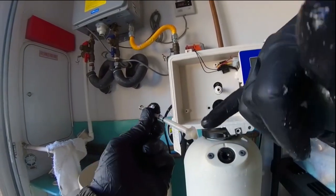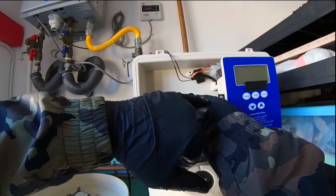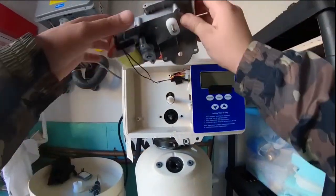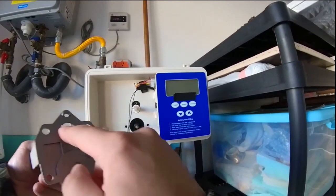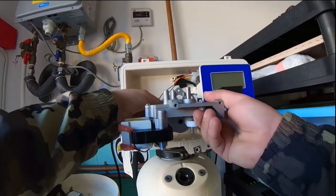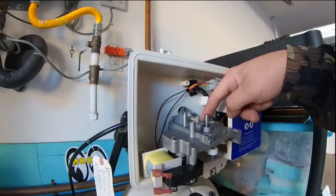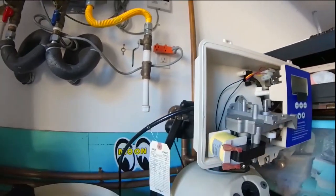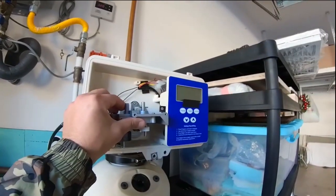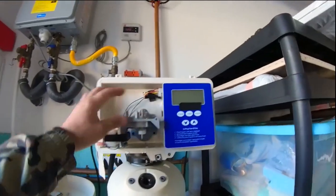When you put the brine piston back in, make sure the rounded part is facing up and the longer part is facing down. When reinstalling, you're going to grab this plate that we took off — it has two notches that are going to line up with the notches on the brine piston. Turn the piston slightly sideways to get it in, then make sure the bottom part of the brine piston is in the groove. Grab the proper screw and screw it in — not all the way tight, just snug.